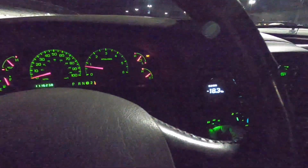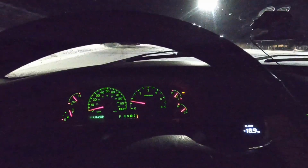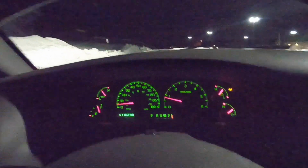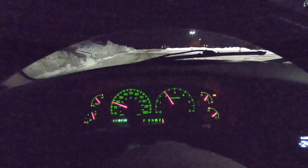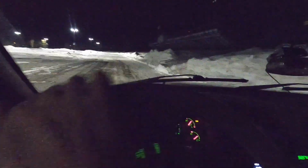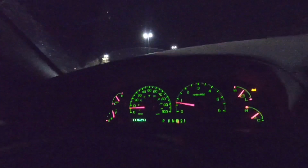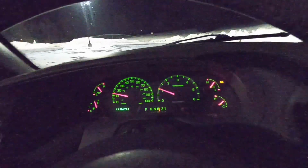I think my four-wheel drive is engaged. Lights on. Sounds amazing, but I don't think we're engaged. Turn, feels like the front diff's engaged because there's a little bit of resistance to turning, but it feels like the transfer case isn't engaging. That definitely puts a damper on the whole four-wheel drive donuts thing. Yeah. Well, four-wheel drive's not working. Can't imagine how that happened.